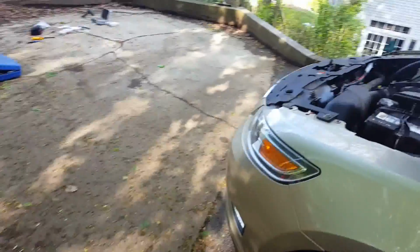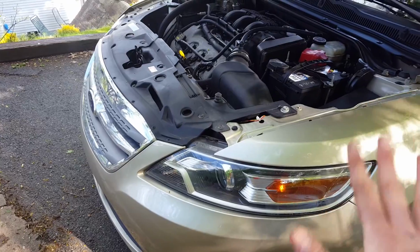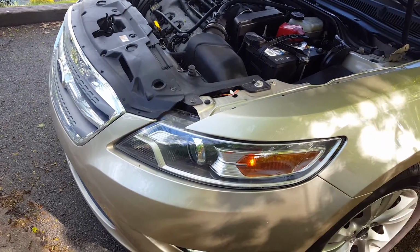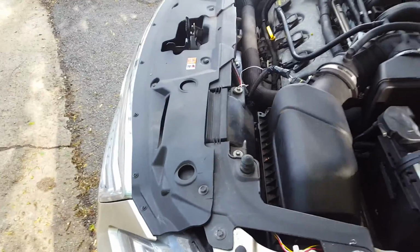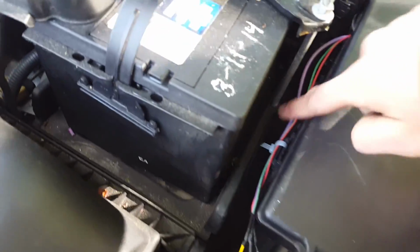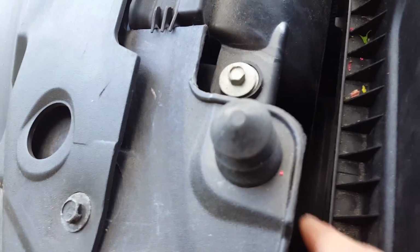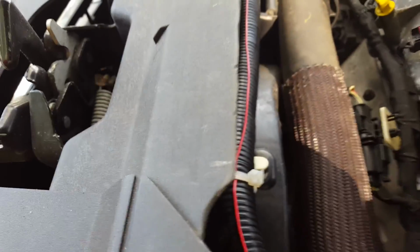And that's basically it. You should know what to do after seeing this video. If you have no idea at all after this video, then don't try it, because if you have basic knowledge, that should be enough information for you. And always make sure that you work clean, that you have these connection points everywhere, and that you orient yourself on the original cable trees so that you have the cables all secured.